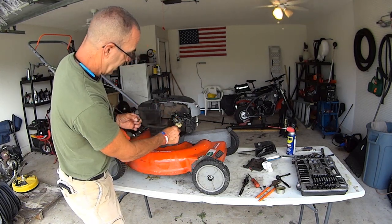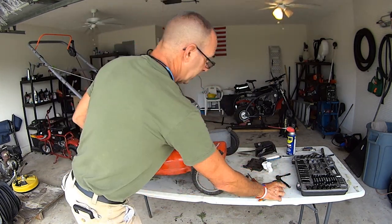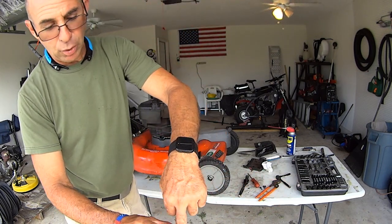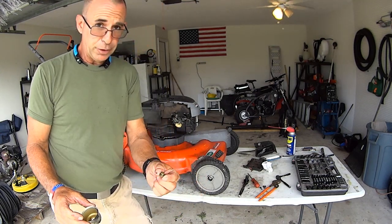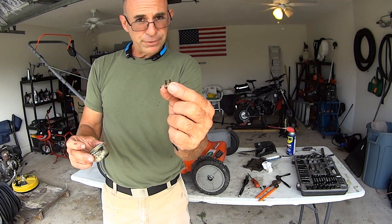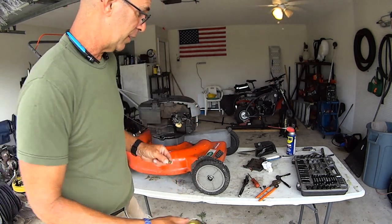The tube coming down that this bolt bolts to is threaded, and it has a hole on each side of the tube that sits in the bowl that sucks in the fuel. And I said some of them, when I made that video, are actually the bolt itself is the jet. And that's what sucks in the fuel, and that's what this is.